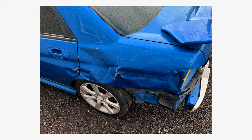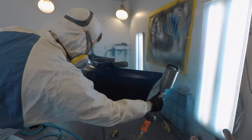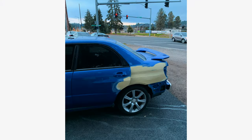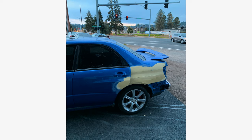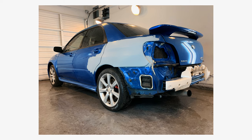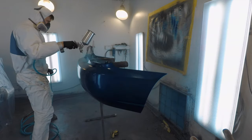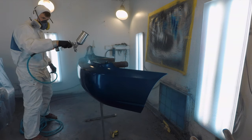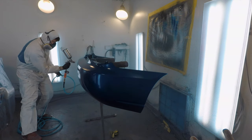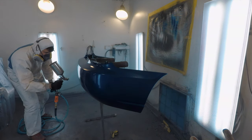Anyway, this is how the car looked — it felt like quite a bit of work, though not too much if you're an auto body guy. It was drivable. I did have to work quite a bit with that quarter panel. Ideally you're supposed to change the skin on this kind of repair, but I went ahead and just straightened it out, pulled it out, and did some sheet metal work to it — and of course the bodywork, the body filler, Bondo some people call it — applied and primed it, and now it's time to paint.